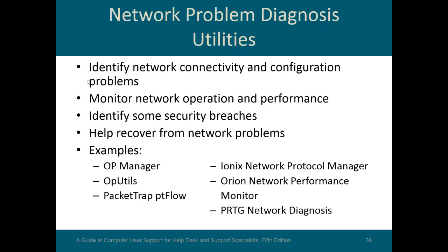All right, network problems. Every network card has a bunch of different utilities built into it. There are a ton of different network diagnostic utilities. Most of the time, you just want to see what kind of bandwidth is going through your NIC card. And you want to be able to ping your NIC card, so ping 127.x.x.x, to make sure your NIC card's responding. If it is responding, you want to put some kind of flow control or something on there where you can actually watch the bandwidth being utilized. Is something choking it off? Is my network card acting erratically? Things like that. A lot of times you can just download a big file and then just watch the bandwidth and see what's going on.